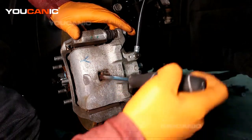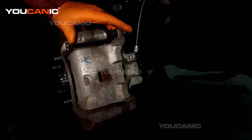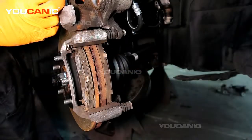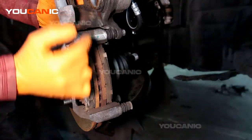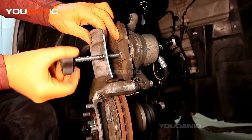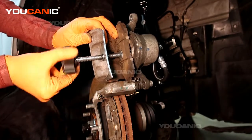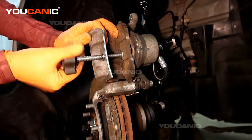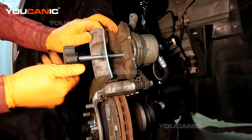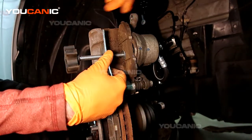There's more than one way to do this, but I like to put a screwdriver in here just to get a little bit of pressure off the caliper, and then you can just twist this up. With that bolt holding it, we can push this caliper back with the brake pad sitting in there, keeping it nice and level as it pushes in, and you also won't over-press it because it hits the guides on the back.